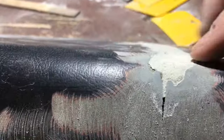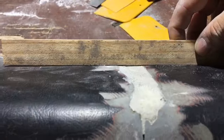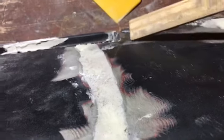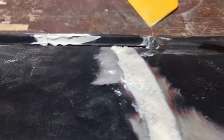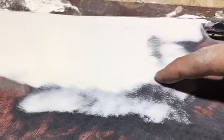So what I'm gonna do is I'm gonna even up and fill this area with filler, and then I'm gonna come out to where this paint stick is nice and even all the way across. See how much filler I'm putting in? I mean, I'm hardly putting any in. So around this area right here, we'll get probably some filler, but I'm feather edging it all back in to where it's nice and smooth. Like see right here, you can see that I've got filler all the way out to here. But if I zoom in closer, you can see the speaker grilles.